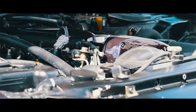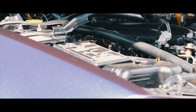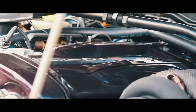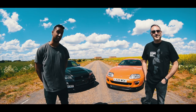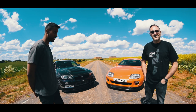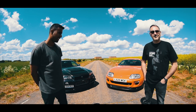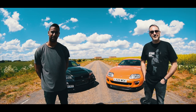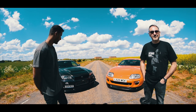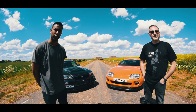Mine engine wise is stock internals, but I've gone single turbo conversion with a precision 6262 ball bearing twin scroll turbo on a 6 boost manifold. Turbo Smart 50mm wastegate with a screamer. Injector Dynamics 850 injectors. Tomei cams, HKS adjustable gears. Nismo intercooler. Custom turbo pipe work done myself. 3.5 inch turbo back exhaust to custom downpipe to Blitz and Airspeed 4 inch.